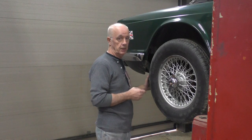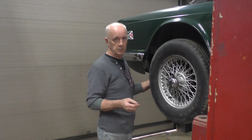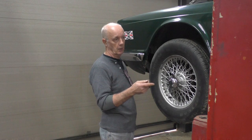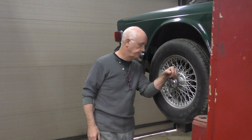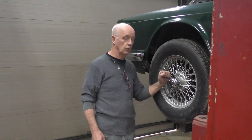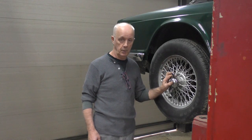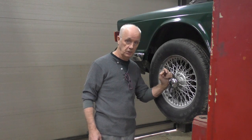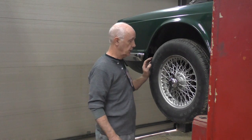It's the same on the other back wheel, and it'll be the same on the front. I can test the front splines easily — just get somebody in the car, put the brake on, do the same thing with the cover and try it. If the wheel has the same amount of play, the splines are worn. All the splines in the wheels can be worn, and it's no good just buying new wheels because the splines they go onto are liable to be worn too. If you put new wheels on old splines you'll wear the new wheels out quickly, and vice versa — it's quite an expensive proposition.